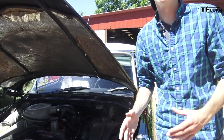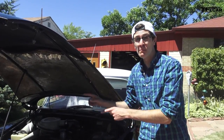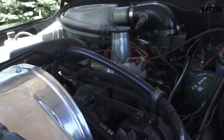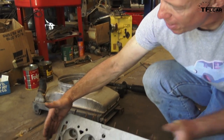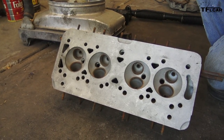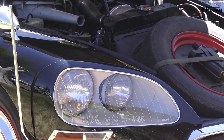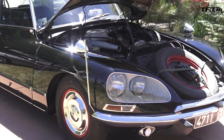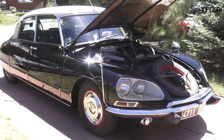It's a Hemi — just like that famous Hellcat, perhaps a little bit less powerful — but the Citroen DS does have a hemispherical head, simply meaning hemispherical combustion chambers. If we had two more cylinders at a glance, it would look like an E-type Jaguar. It is mounted longitudinally, so it's a front-wheel drive car, but not like modern front-wheel drives — it's not sideways. This is longitudinally mounted with a transaxle ahead of it; the transaxle is the furthest forward in the car, and the radiator sits on top of it. It's very reliable — 200,000 miles is easy with care. There's great torque, good enough power, and with the aerodynamics, high speeds were easy. It's just that you weren't going to win any stop-sign Grand Prix's.